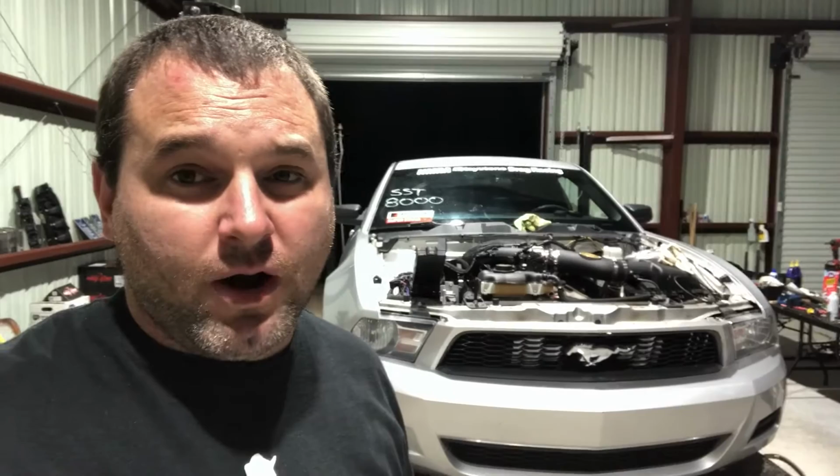Just to dial in our suspension and try and see what we can do with the new converter, because converter and gears, thumbs up, because they are killing it as far as making the car accelerate faster and launch better. I mean, just simply we cut 2/10 off the time just with the 60-foot going down, and it wasn't even a hardcore 60-foot, it was like a 1.8. That's like 2/10 off our normal times in this car.